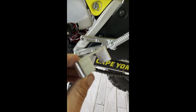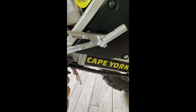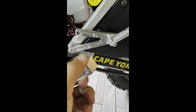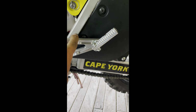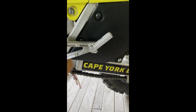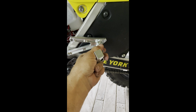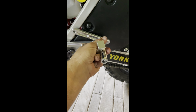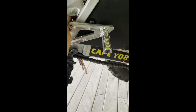So I'm gonna have to sit down, have a think about it, and come up with a game plan to work it out. What I'm sort of thinking is cutting this off, get rid of that piece, and then do a nice drill hole straight into this subframe, so it's locked in that way, and it's also locked in here with this screw, which will stop any movement. Any download though is down here, especially if someone's jumping on, standing up, so that's where all your load is, but it needs to be in and tight.